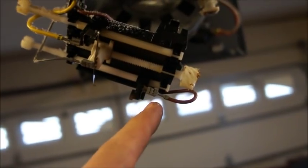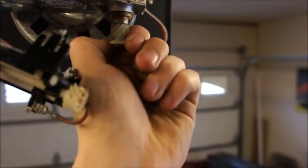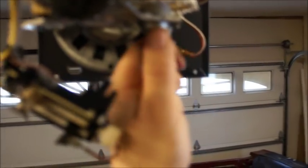You want to make sure the limit slider is not on the down position. If it is and your chain is in the up position, turn the small gear until the slider touches the yellow wire contact. You're also going to want to pull off the limit gear — there's a small clip you need to separate. The new kit comes with one, so I'm not concerned if I break it. Small W-clip, and the limit gear pulls straight down. Those two can go in the garbage. Also disconnect the connector for your RPM sensor — be careful not to damage it. You can also pull the wheel off of the shaft of the motor; put that in a safe place because the kit does not come with a new wheel.